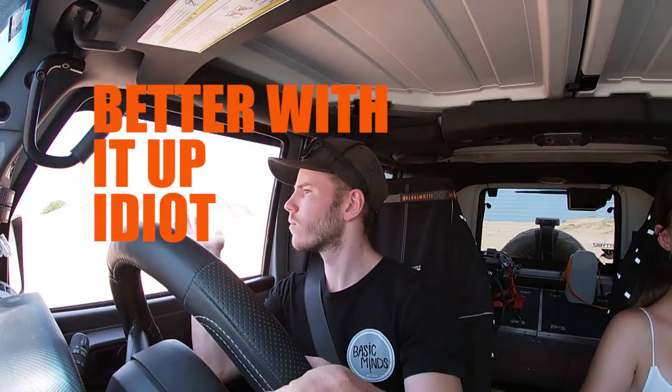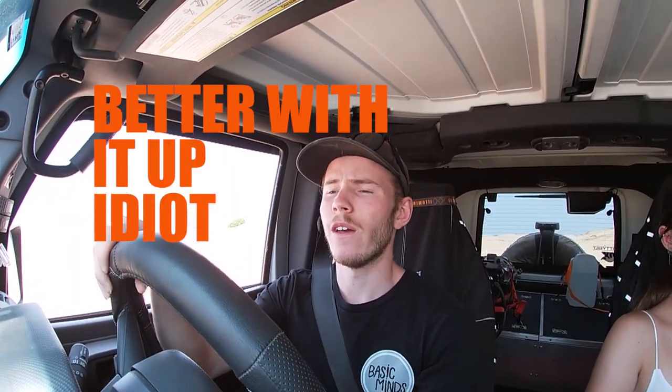Alrighty, so I'm currently in the process of trying to get myself bogged. I'm in two-wheel drive, 16 PSI on my tires, and as you can see, with my window down, I'm just cruising. So it really goes to show that tire pressure is what matters the most when going beach driving.